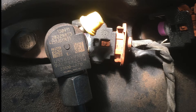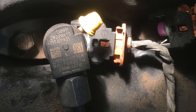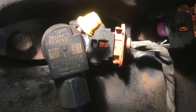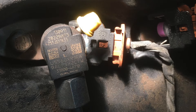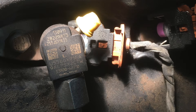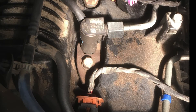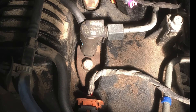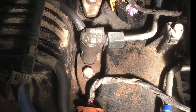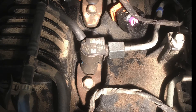These have a problem if you've done something with your fuel system and now the vehicle won't start. That's because if these aren't bled properly, what happens is the compression of the motor gets up inside the injector and actually jams something up inside the injector itself.